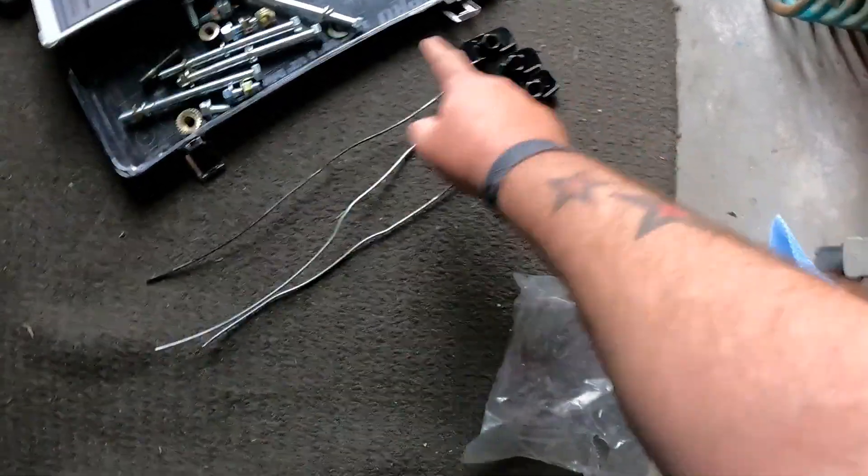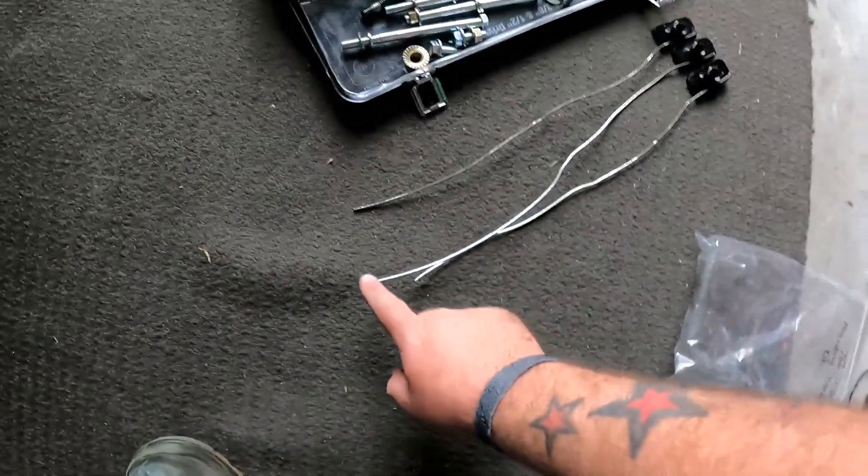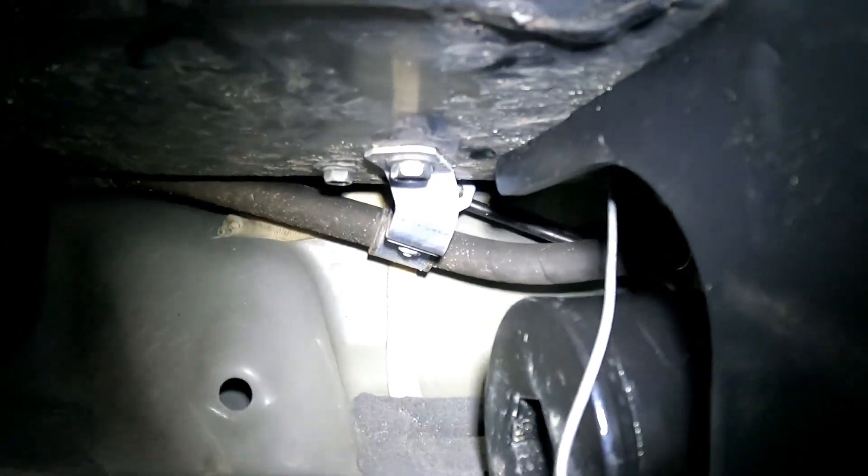One bolt down — we're going good. Another pro tip: a couple of these captive nuts have slightly longer tails — not much, but like an inch. Save the ones with the slightly longer tails for the front, because you'll need the length there. The bracket sits nice with the HBMC unit. That's our bolt hole, and that is the entrance for our captive nut. We're going to get the captive nut through there and then put the stud through there. I can see the hole in the chassis — that's where the captive nut fits through. I'll get a bit of dental floss on this: put the stud in through this hole, wrap the dental floss around it, tie it up, then pull the wire with the dental floss tied to it. It'll pull the floss through and hopefully I'll be able to pull the stud through with the floss.